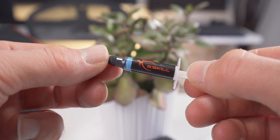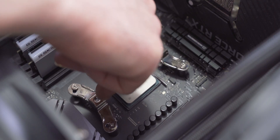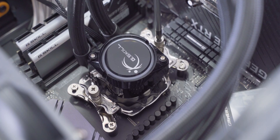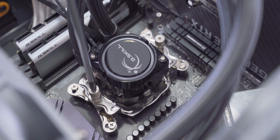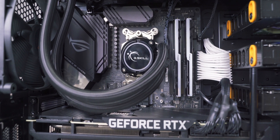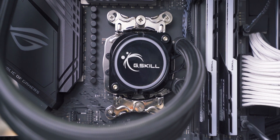I'm using G-Skill's server-grade thermal paste that they included with the AIO, which, by the way, happens to be blue. The water block fits right on top of the CPU IHS and then gets tightened down on either side with some spring-loaded screws, and I'm just alternating back and forth between the screws as I tighten them down so that the tension's applied evenly across the cold plate. The PWM connector from the pump goes onto the AIO pump header on the motherboard, the three-pin ARGB goes onto an ARGB header, and then finally we can connect the fans. For some reason, they chose not to include a fan splitter cable for the three fans, so you're either gonna have to get your own if you wanna chain them all together, or install them separately onto individual headers on your motherboard. And this is how the AIO looks installed in the top section of this BeQuiet Silent Base 802 mid-tower PC case.